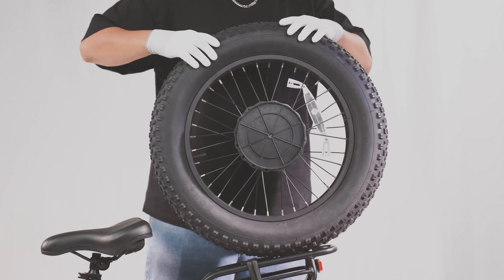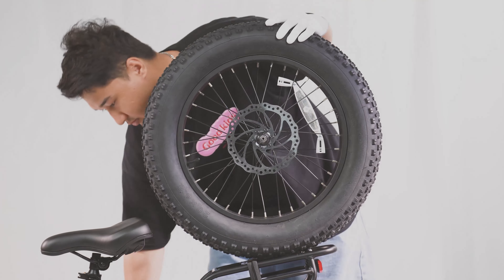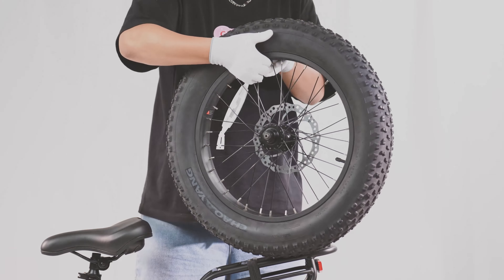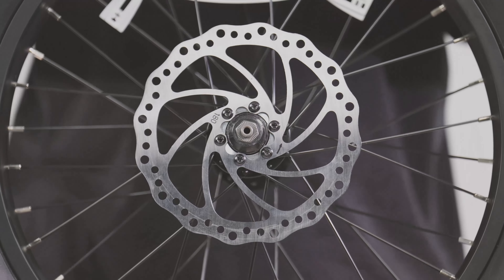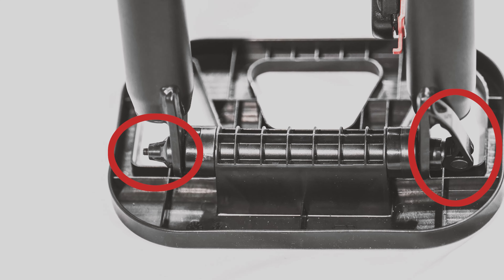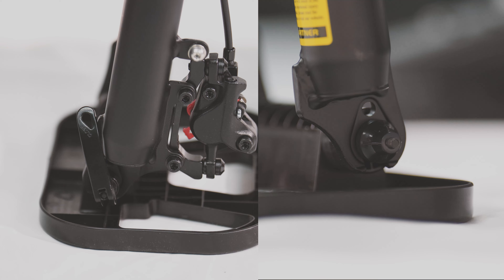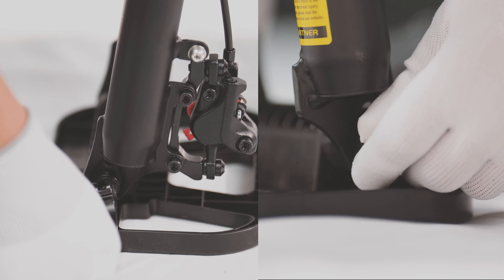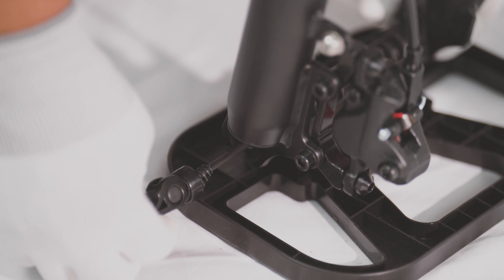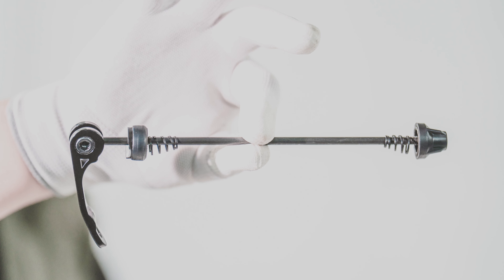Before installing the front wheel, remove the wrapping on both sides of the front wheel. Next, let's talk about quick detach handles. Remove the lever of the quick release located at the bottom of the front fork by swinging the quick release lever and holding the thumb nut on the opposite side. Keep the quick release, which will be utilized later. For the installation of the quick release mechanism, you can refer to this diagram.